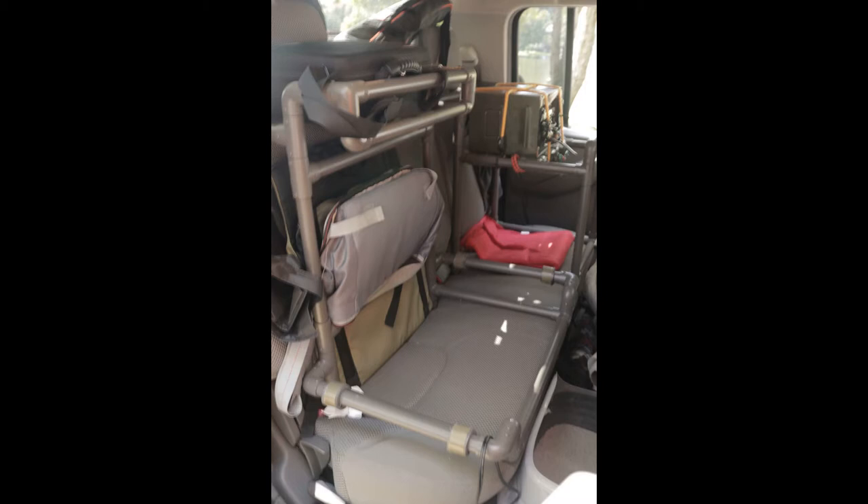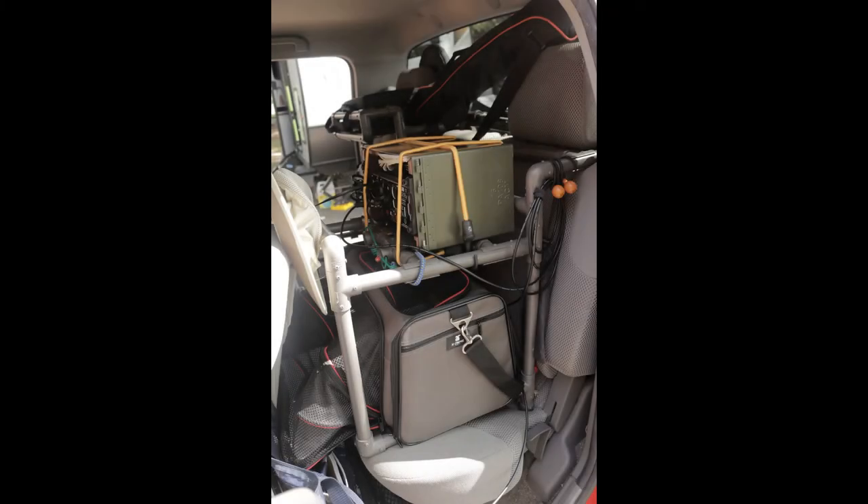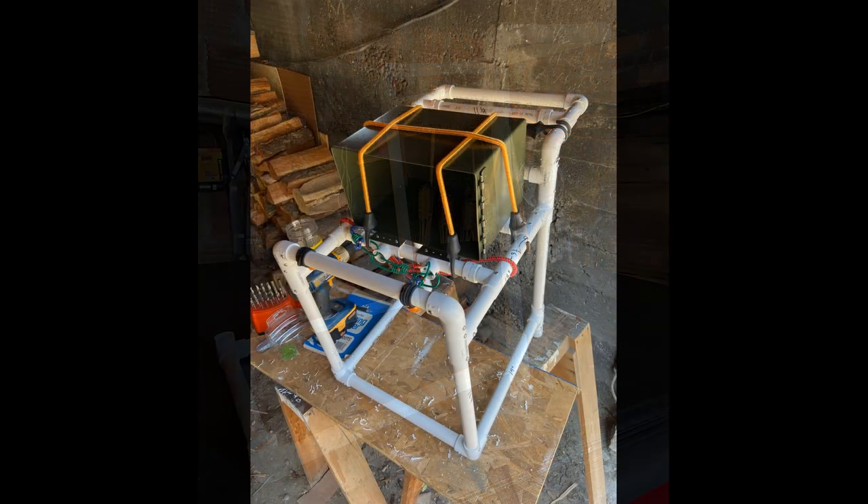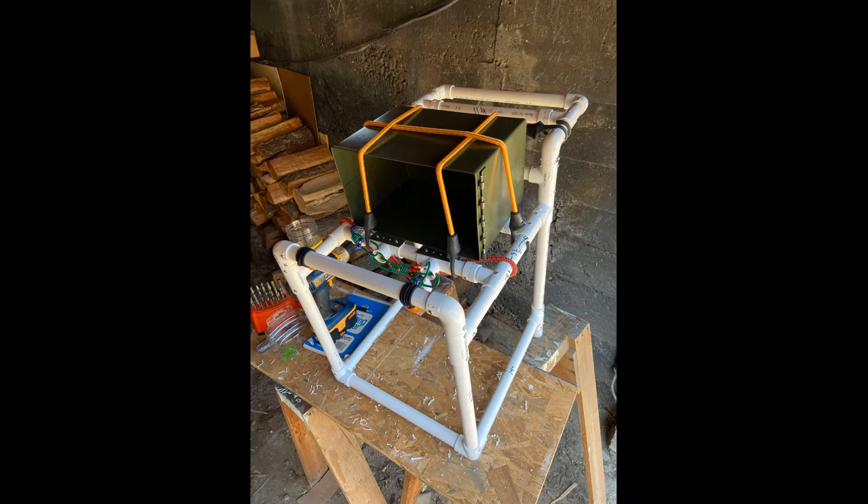I used one-inch diameter thick-walled PVC pipe throughout. Tabitha's carrier and the mobile ham radio share the driver's side. The frame rests on the seat with an extension fitting behind the headrest to hold it securely in place. Note the short legs extending down on the rear of the bottom to provide four solid points of contact. A sealed lead-acid battery makes the overall weight of the radio box 20-plus pounds. I started by trial and error fitting and trimming one side of the frame, then using the empty radio box as a sort of template, I put the basic frame together. Here's the finished frame before spray painting it a dark gray, which is a close match for the truck's upholstery. The radio box rests on two steel tie plates screwed to PVC cross-members. Tie plates are found in the electrical section of your local big box DIY store.